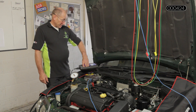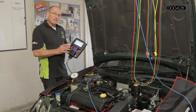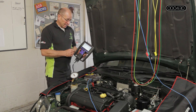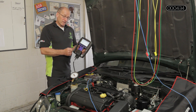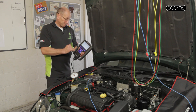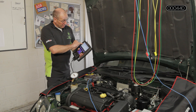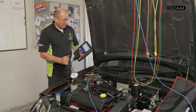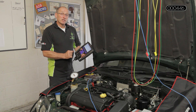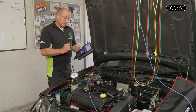The first opportunity of test with any pressure sensor is what we call plausibility: what is its value when there is no activity in the circuit? We are measuring a manifold with the engine not running, so there should be one atmosphere in there. Simply key on and take a look at manifold pressure: 101.4 kPa — that is one bar of pressure. I'm quite happy with that, so the basic plausibility is good.